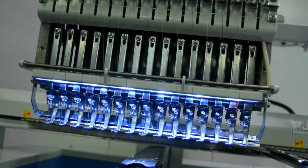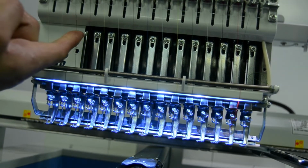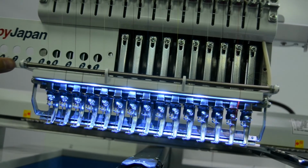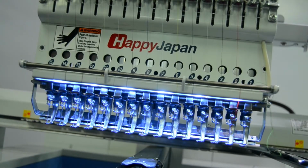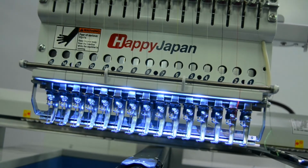Finally, replace the lower faceplate, inserting it carefully from the left, making sure that it's underneath the lip of the upper faceplate. Putting the screws back on to hold it. Don't overtighten these screws as they are short and only meant to hold the cover plate on and not endure any kind of drive stress in the sewing process. And now we're finished.